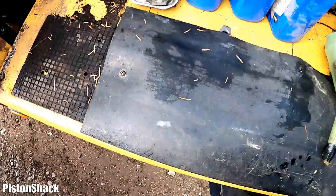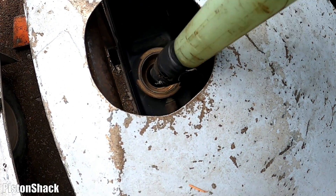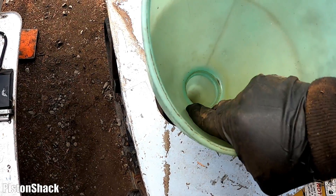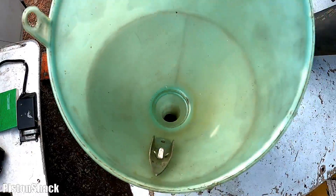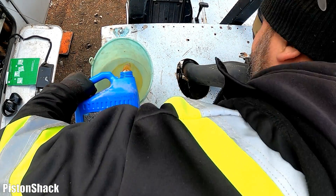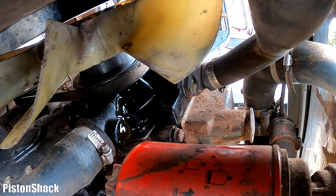Let's climb up. Radiator cap is removed. Let's get our funnel in and make sure the funnel is sealed around the radiator neck. Okay — I'm going to start putting coolant in. Coolant started coming out here.